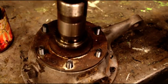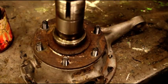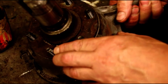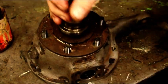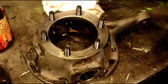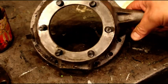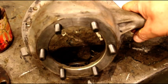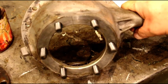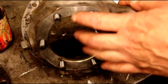So, if you get everything done right, your spindle should fit right on there — there shouldn't be any trouble with that. Again, you've got your spindle and your brake backing plate. I use a lock nut on here. You've got to make sure your studs are the right length depending on what kind of hardware you're going to use — whether a lock nut, nylock nut, or some type of metal locking nut. Size your bolts correctly. And that is one indestructible knuckle. It doesn't take much to do. Chuck's on the other side of the country, 3,000 miles away. When he's out on the trail, I don't ever have to worry about a failure at this particular point.